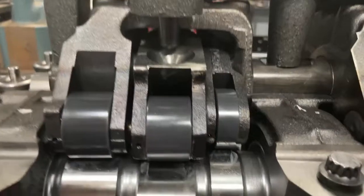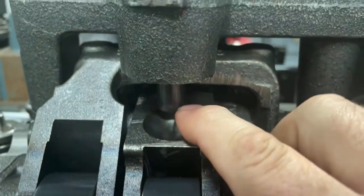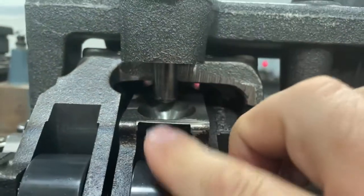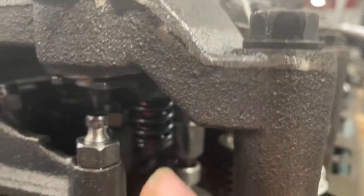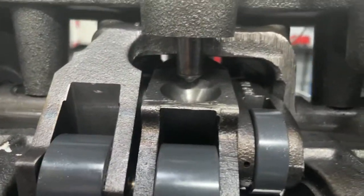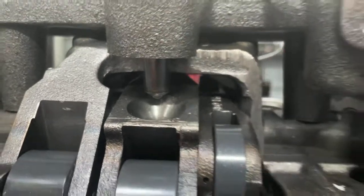Just a quick editorial correction: during the video I kept mis-referring to the master pistons as slave pistons. The thing that the rocker arm pushes up on into the housing is the master piston, and the ones on the other side that push down on the exhaust valves are your slave pistons. Just a mental error on my part — I didn't want to re-record the whole thing, so just pointing it out now. Master piston controls the slave piston — keep that in mind.